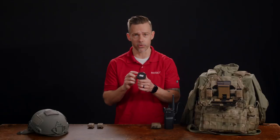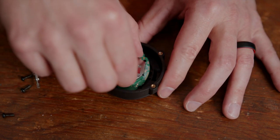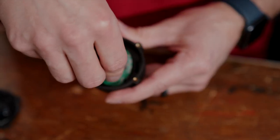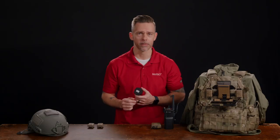We also have four screws on the outer edge of the unit — similar to the ones on the standard R30, these are what you would remove to replace the battery. This one also uses a CR2450 battery and the replacement procedure is pretty much the same: remove these four screws with the T8 bit, remove the backing from the R30SB, pull out the circuit board with the affixed battery housing, remove the old battery, replace with the new one ensuring the positive end is lined up with the positive etching on the housing, and then replace the circuit board. This one doesn't have the guidance pin like the last one — instead it has three little guide half-moons that line up with the circuit board only one way, so just make sure they're oriented properly and then screw the backplate back on. The battery should last you a couple of years of steady use.